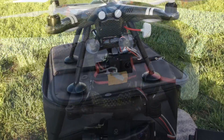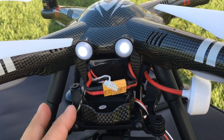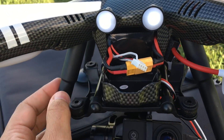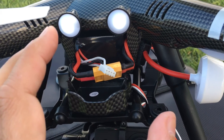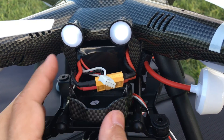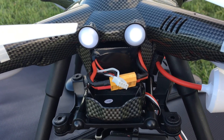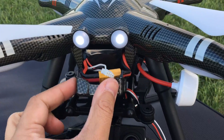A little over 15 minutes — that's reasonable for the stock battery. Now let's see what the 7,000 milliamp battery can do. We've pushed in the 7,000 milliamp battery. A word of caution: even though the battery is very similar in size to the stock battery, the little bit of extra size causes you to wedge it in more than normal. It's very tight in there — the wires and the door you could barely close. There's a higher risk of maybe damaging something, so just be aware of that.